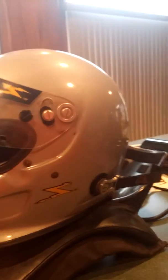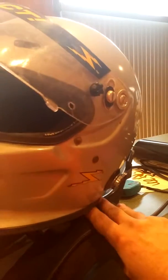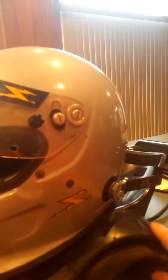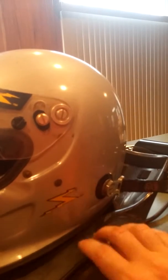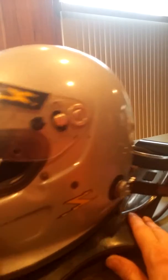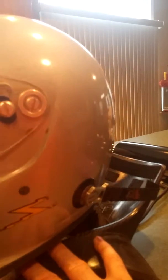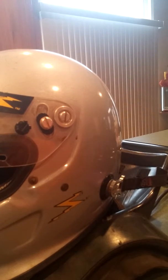Now that you're connected to the Hans device, your seatbelts would come on. You can see there's no way for your helmet to go left or right or forward — that's the whole purpose of the Hans device. We can stop these cars at 100 miles an hour, no problem. You stop the body, but the head always kept going, and that's what leads to very bad days for race car drivers. That's what this tether system addresses — when you impact something, the belts are strapped to the car and the Hans device means your head can no longer go forward. It's a really simple device but very effective.